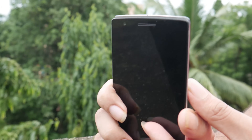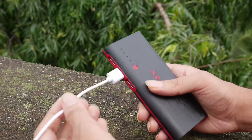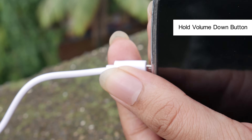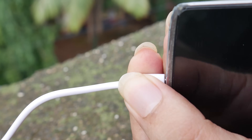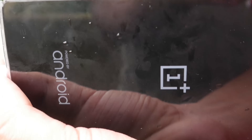Get ready with your power bank, hold your device comfortably, and keep pressing the volume down button. While you do so, insert the micro USB pin into the charging port. You'll see the phone boots into recovery mode. It doesn't matter which recovery mode you are in — TWRP, PhilZ, CWM, or stock — as each of them has a common option: reboot device.